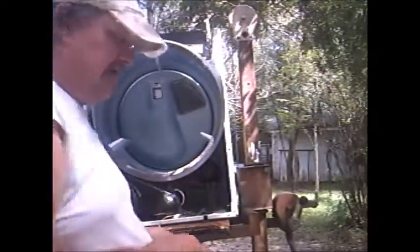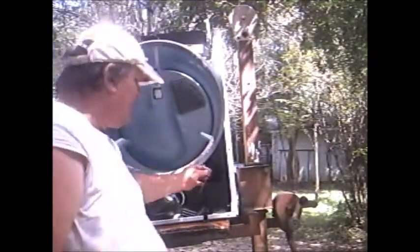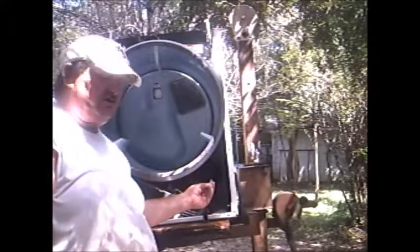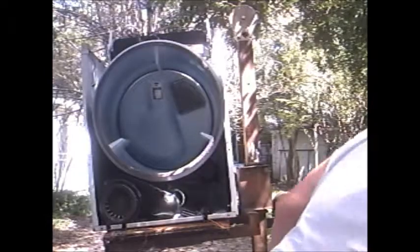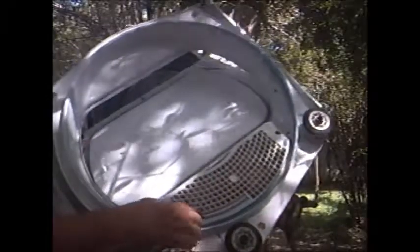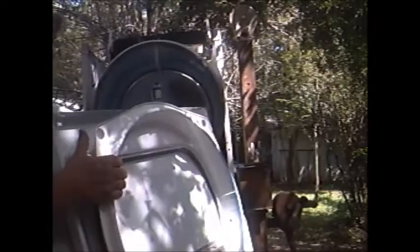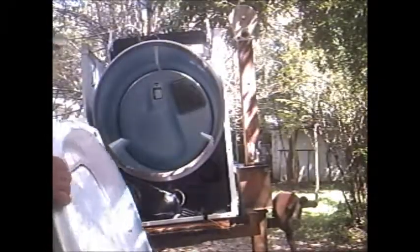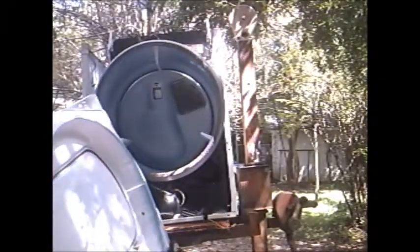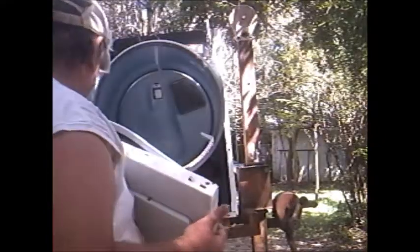Now here's the important thing. You got this yellow wire right here — that goes to the sensors. The sensors is what the clothes rubs against, and the moisture from the clothes makes them discharge the capacitor faster. As long as they're discharging it'll stay running. Try to put this on here.